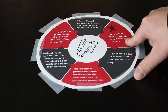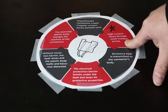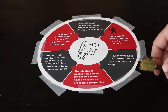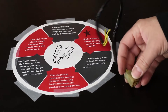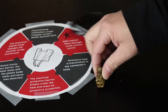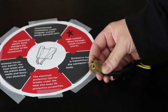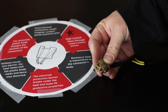This is a chain reaction, and once it gets started you can't really stop it, so it is important to maintain the connectors and replace them when necessary. Here's a good example of a really badly damaged connector — a common style used on motorcycle and ATV stators. You can see how badly this one is melted. This was on a stator used with a regulator that had failed, which caused the whole chain reaction to start.